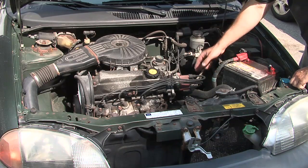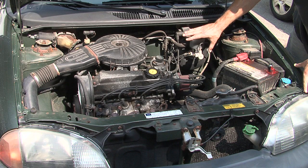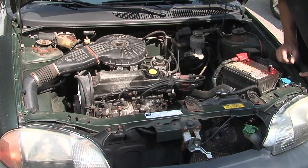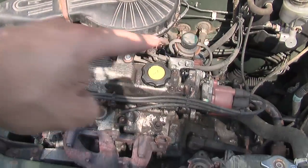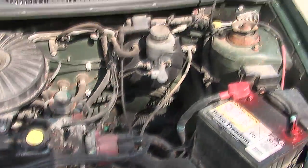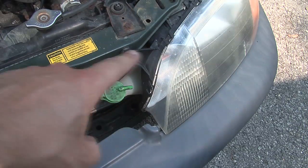The transmission we're going to keep and reuse. There's really not a whole lot of other things up here. We've got the brakes — we're going to keep all that — except these are power brakes, so we're going to have to figure out a vacuum for making the power brakes work. Coming off of the engine, we've got the exhaust components, and all of that's going to come off as well. Just a little overview of the engine compartment: we've got the windshield washer motor, the air cleaner for the engine, and the exhaust manifold — all of this is coming out. We're going to want to keep our windshield washer fluid. Down here is for coolant — we're not going to be using any coolant anymore, so that can come out as well.